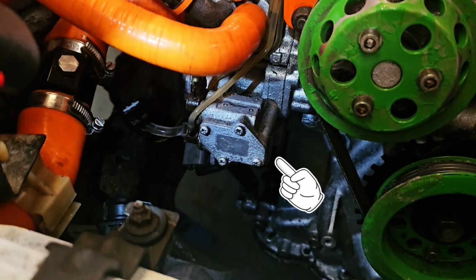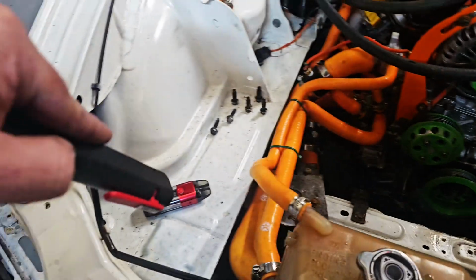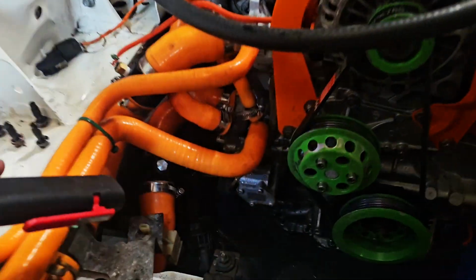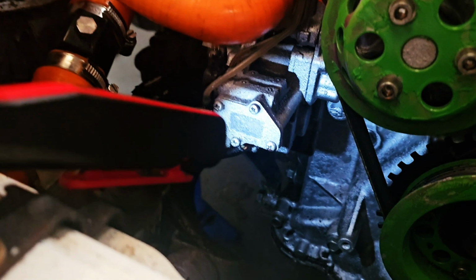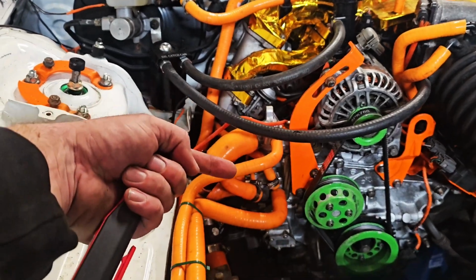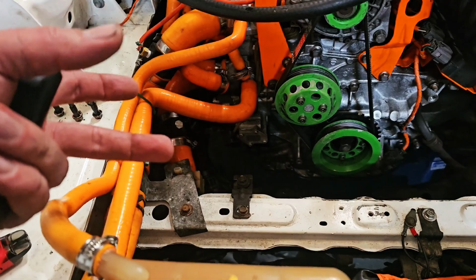Okay, there's the oil metering pump. On my car, relatively easy to remove. Normally you'd have the ECU and everything here, the battery, the airbox, all this crap in the middle. I don't have any of that. So I managed to get to these 4 feed pipes from up here. The one bolt that holds it to the engine, and then get underneath, and on the back end there's 2 more bolts, which are all removed. Taking the electric clips off, so now this should just pull away.